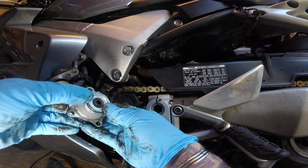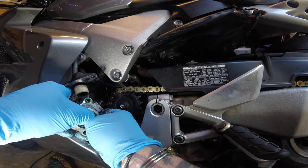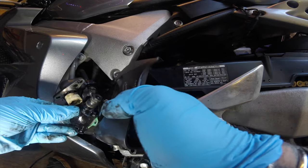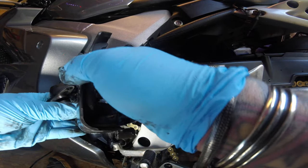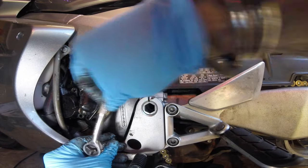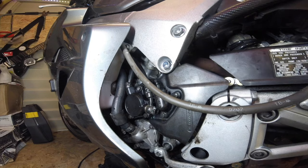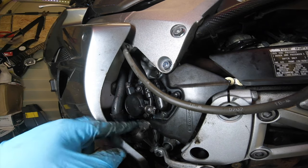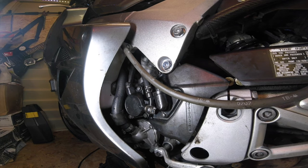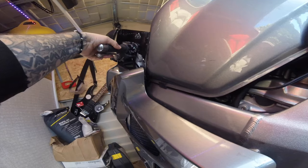We accidentally pressed the clutch lever, which pushed the piston out. Now I've got to try and do that without it popping back out again, which is going to be fun. The slave cylinder piston popped out so it wouldn't go back on the rod, so I've had to push it on as I've been doing it - but it went on quite easy, it wasn't too bad. I'm just going to tighten it up a bit now, then all we need to do is put the split link in and we're good to go. Yep, that feels normal.